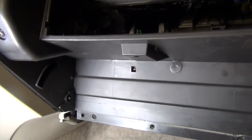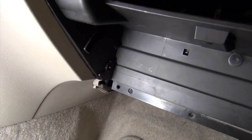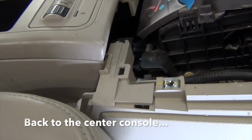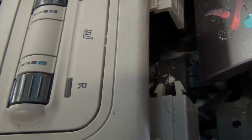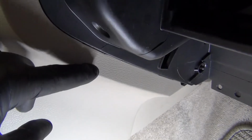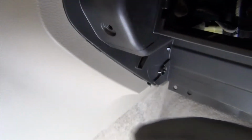Next step, it's kind of a doozy. It's to get this piece out, and it's a little tricky. It's 2 screws here, but then there are a series of clips behind here that can be a bit tricky to get out, but just be patient and work your way through them. Okay, with it partially disengaging a little better, see what I'm talking about there with that under clip and then that center clip there. Now you do have to pop these guys up and free, there and there, and now all it's held by are a couple of clips between these 2 pieces, and I'm just going to use my trim tool to separate that. And what I'm going to do is slide in this way and kind of twist it to just separate them.